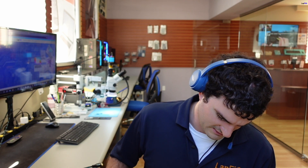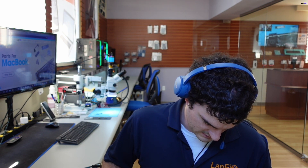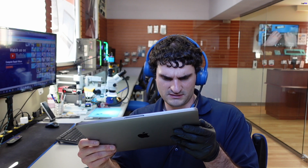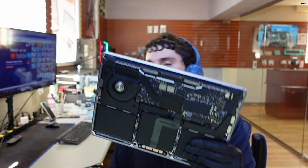I thought I was getting something — let me check a few more times. Okay, yeah, it's completely dead. I believe the notes said there was like five volts going on and it wasn't charging, so most likely there's a problem with the port. We obviously need to open it up. The back cover is already off; it doesn't look like it's been opened before. We want to scan the board anyway and see what's going on.